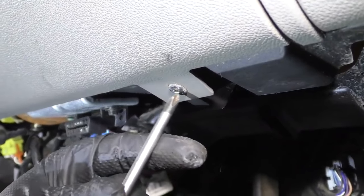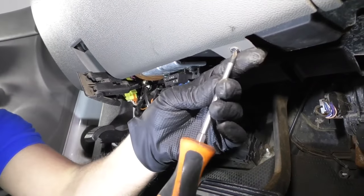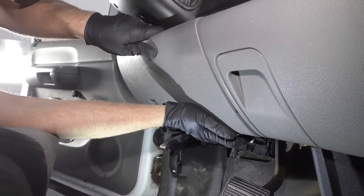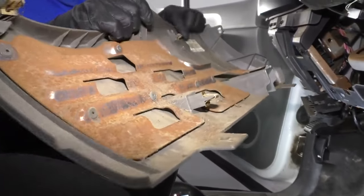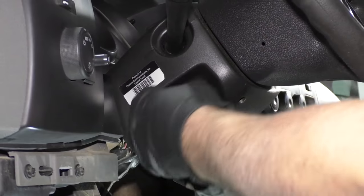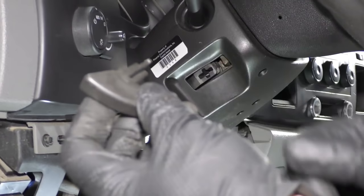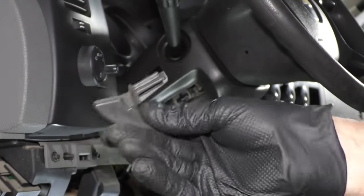Next I'm going to remove two screws. There's one right here, and there's also one over here — on this vehicle it's missing. It's just a Phillips head screw. Take that out. Now I'm going to grab this panel and pull it straight forward. There are clips on the backside right here, right here, and right here. Next, I'm going to grab this handle for the steering wheel adjustment and pull it straight outwards — just pull it off. This generally is very hard to get off. If you have to, just try to get a little screwdriver and pry it out, but you really have to force it.